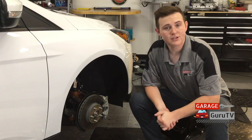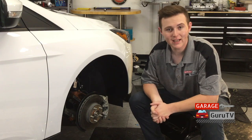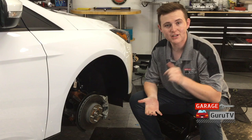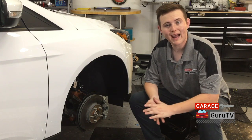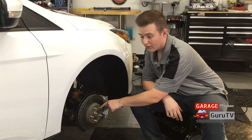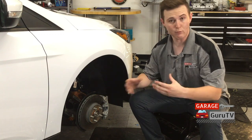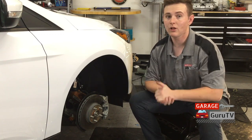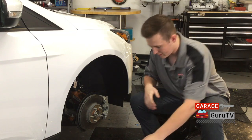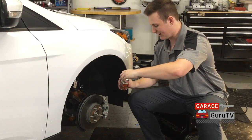The car's up in the air and the wheels are off and we're about ready to put the H&R Track Plus Wheel Spacers onto our 2018 Ford Focus SEL. One thing you must remember when installing any kind of wheel spacer, but especially the H&R Track Plus Wheel Spacers, is that you want to add a little bit of anti-seize to both the mating surfaces, the hub ring, and the lug studs. The anti-seize makes it so that these two metals don't basically weld themselves together. If they do, you won't be able to get your wheel or your new spacers off if you ever need to do any maintenance. So apply the anti-seize pretty liberally onto the mating surfaces.